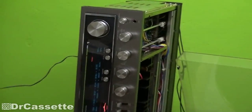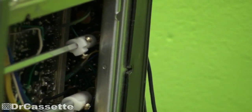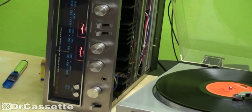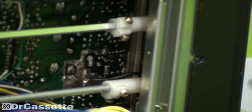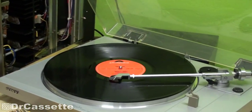As for the phono part, when I first put this together the input selector was screwed up, so I had to fix that. There is a switch in the front and a switch in the back, and those switches were in different positions, so that was messed up. To fix it I had to take off the bottom panel in order to reassemble this, because you have to reach these parts right there - those won't fit onto the switches in the back automatically when you put it back on.